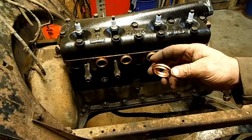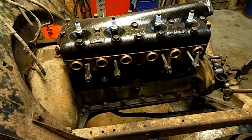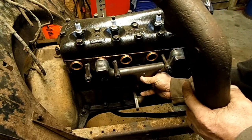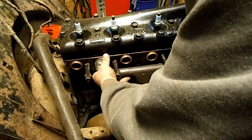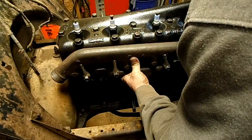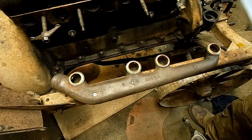These are the updated style of gasket for the intake and exhaust — they're just little copper rings that kind of snap in and hold in there. I've cleaned up my intake and exhaust, just wire brushed them a little bit. It can be tricky to get this to all set in there the way you'd want it to. We know we can do it, but it requires some patience. Let me show you what the problem is, why I cannot seem to get this on.